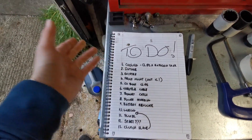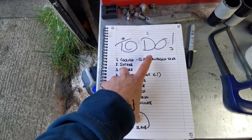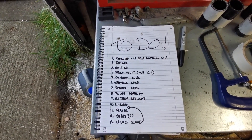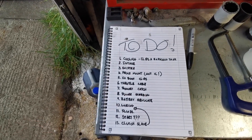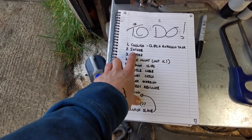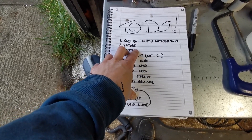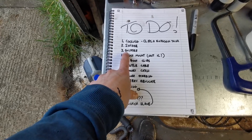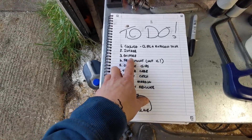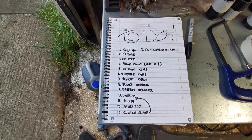I'm actually going to leave the bottom hose — it's a bit of a funky shape. If there's any issue with it I'll change it for the silicon tubes. I still need to put all the hose clips on and sort something out with an expansion tank — I was considering having to do some ali welding myself. I've got to 3D print the intake properly; anyone who watched the older episodes will know that didn't go particularly perfectly, and I'm also waiting on a silicone bend for that. The shifter is pretty much complete, I've just got to clearance that extender piece a little bit so it shifts properly.